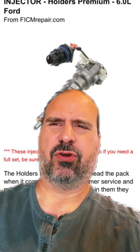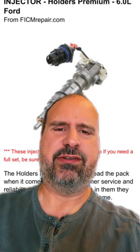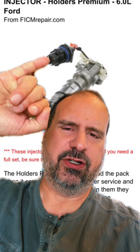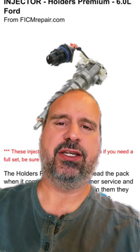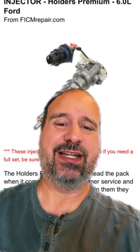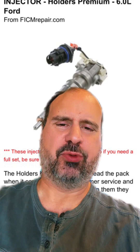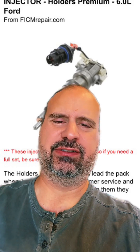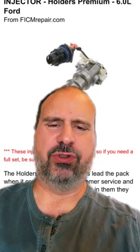If it is a Motorcraft or a Holders injector, I doubt seriously it's the injector — it's something else. But go ahead and do a continuity test. You can take your digital voltmeter and just ohm out the pins in there and see what you've got going on. Because a circuit high code means one of these things is not like the other — we don't have continuity, it's an open. So is that an injector problem? If you don't know what to look for, compare one injector versus another, do a couple of them. Google's your friend here.